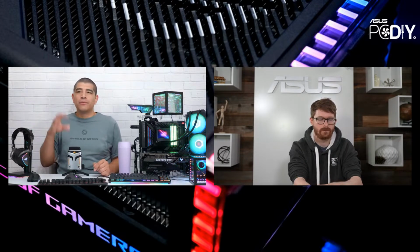So that's the reason why I always recommend that you run the benchmark at stock at least 3 times, so that you have some buffered runs that help give you that consistency. And then same thing when you get into the overclock, if you rerun it at least 3 times, that gives you 3 different sets of data points that you can compare and contrast. And Jake nailed it right there, though. The good thing is don't just look at the average. You want to look at the entirety of those 3 points. And that's why, like I said, it's a great option that, if you want something free that you can try out, is a great tool.